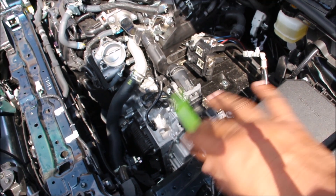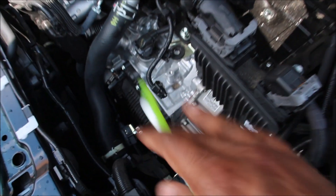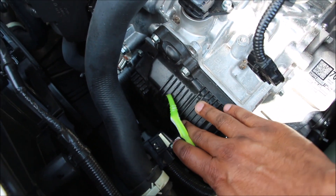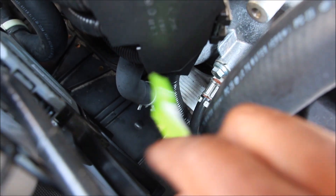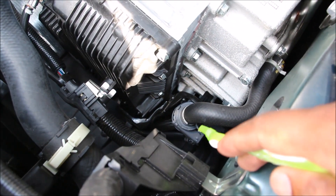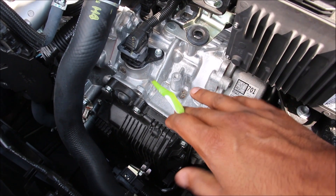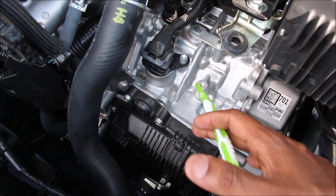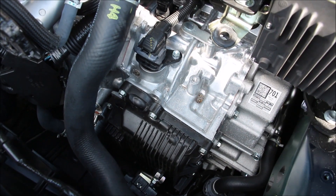Here we have a look at the transmission, which is situated on the left side of the vehicle. It's electronically controlled and its valve body is located in the front of the vehicle behind this plastic baffle. We've also got an integrated cooler that runs engine coolant through the transmission to cool it off, with a valve that controls the flow of that coolant. What's unfortunate about the CVT is it's not that serviceable — you actually need a vacuum gauge, an air compressor, and Techstream software if you want to properly fill the transmission fluid when servicing it.